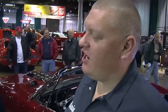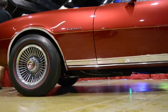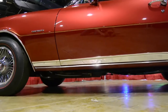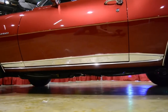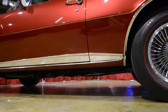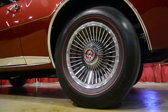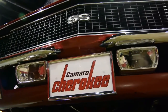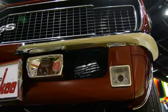So, your involvement with the car — how did it come to you? What kind of condition was it in? The car was never restored before we got it. It was an original white car that they had painted Azteca Gold and shot a red candy over top of it. Back then it was all lacquers, and when you do a candy paint job, you put a ton of material on. So this thing had lacquer-checked everywhere — cleared to the rocker. The paint looked horrible. And being that the car had been a pace car, you could see the imprint on the doors where some of the pace car stickers would have been, because of the candy fade.